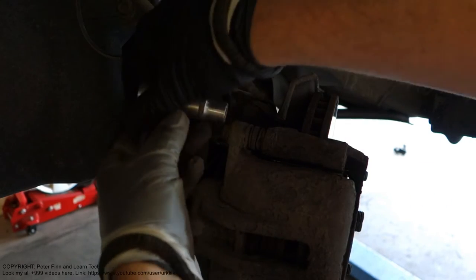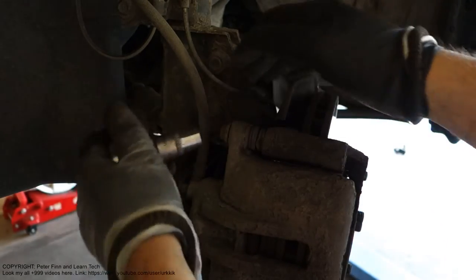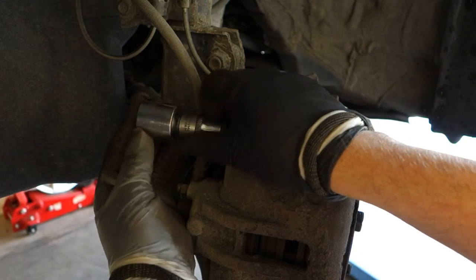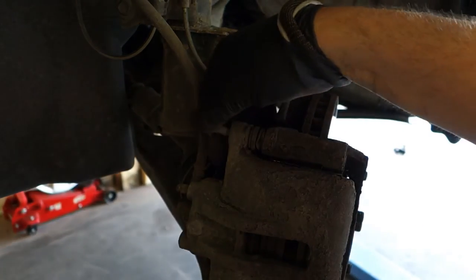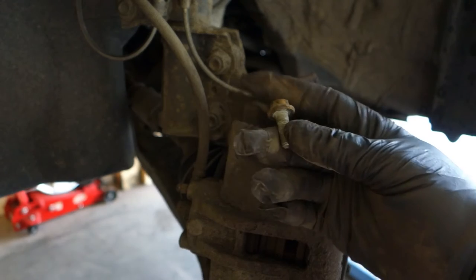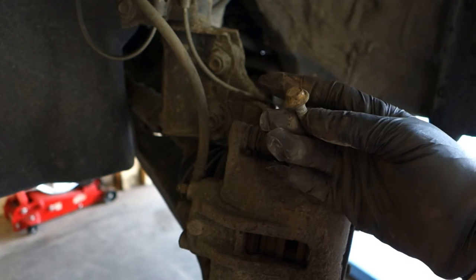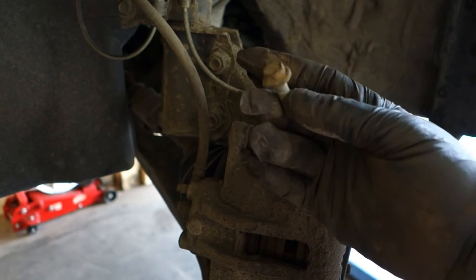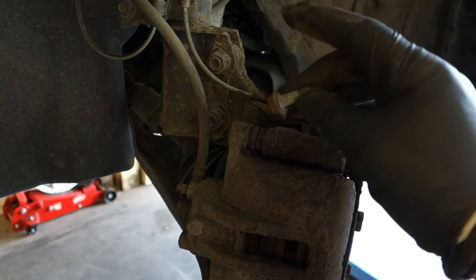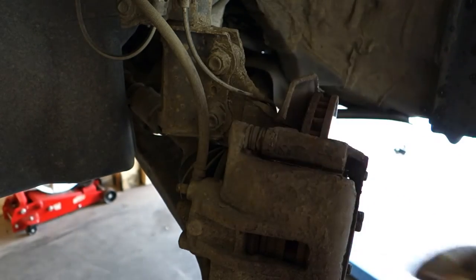And then that one. It's easy to rotate with a nice socket, only by finger, and now the second bolt is free. If you have damaged a bolt, please visit the Toyota dealership spare parts desk, and you can purchase new bolts that cost something like $1 or a euro per piece, and they fit right away. Do not use any other bolts here.